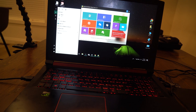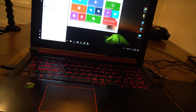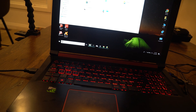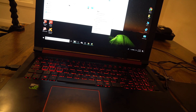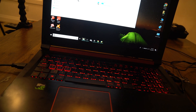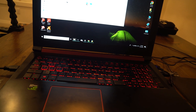Before we actually end up doing this, what I will suggest before we press Disk Clone is, if you have just unwrapped a brand new hard drive that's never been partitioned before, come over to here. We're going to open up this disk, then hit This PC. If you don't see your new disk right here — as you can see this one's just 232 — make sure you have enough room. If I go to Properties, it says I need a 157 GB hard drive. This is 232, so we have 80 gigs buffer. Do not go within 50 gigs — otherwise it could slow the drive down.